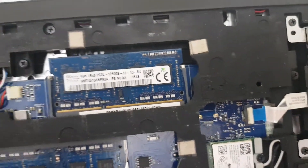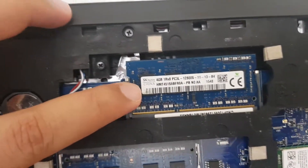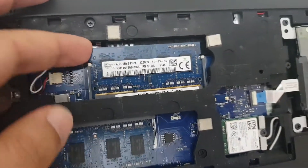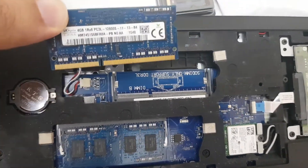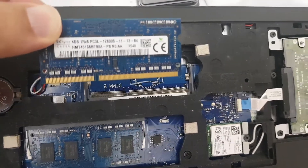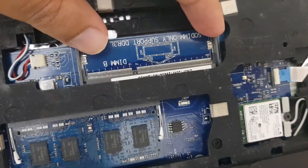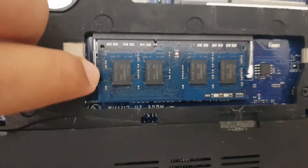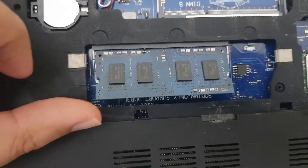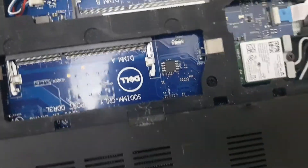How are we going to open them? This one is a tricky one, but let me try to show this. We're going to push these two knobs and it will open automatically. There are tiny clips on both sides — we just need to push them outwards and then automatically the RAM will come out. I'm just pushing this one here, and the one on the other side, and here you see the RAM already moving out. I'm going to remove the second one now.